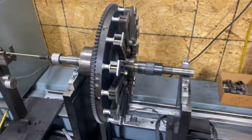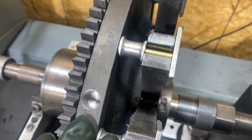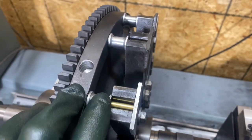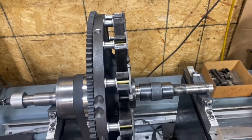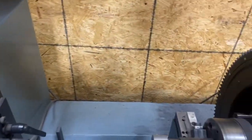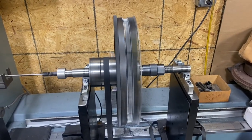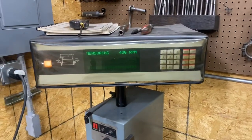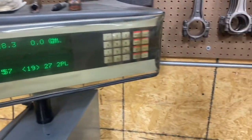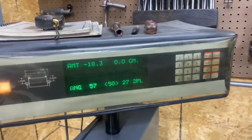I made my correction. This is probably the only correction I'm going to do because it's not that far off. I took a half-inch drill bit, drove about three-quarters of the way down. According to the chart, about one inch down on cast iron or steel is about 30 grams. Let's spin this old girl up again. Perfect — 18 grams out somewhere else. I'm not going to go any farther than 18 grams; that's nothing.